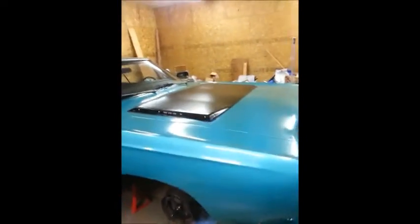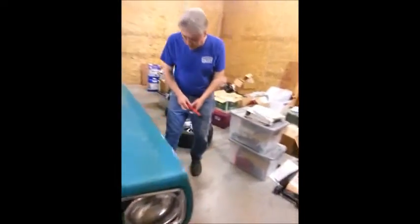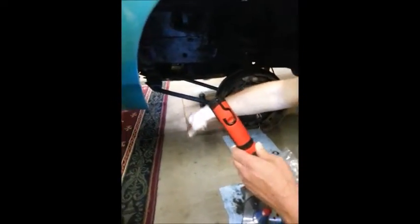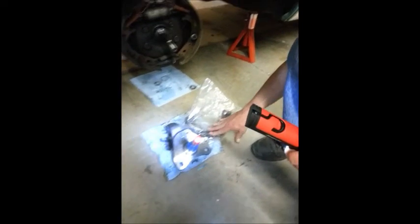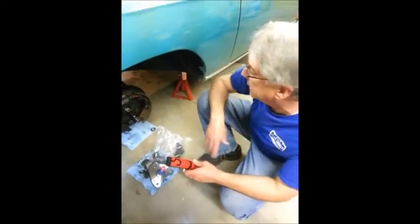So over to the car, just real quickly, I've got one spindle here because I have a front sway bar. Most RoadRunners came with a front sway bar. The caliper cannot set up front. It would hit the sway bar. So these are rear mount calipers, and they did mark an L for left, so at least I know this is the right caliper for this side.